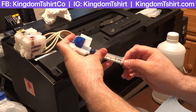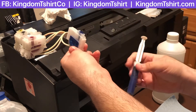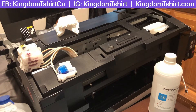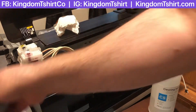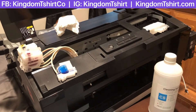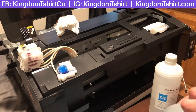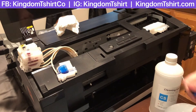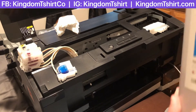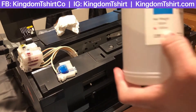At this point it could also be a good idea to replace the damper, even though this one works fine. I'll move the camera a little so you can see better. Now that the damper is almost empty, what you want to do is open your water and fill the ink tank with a little bit of water, then add cleaning solution — or vice versa, it doesn't matter which order.